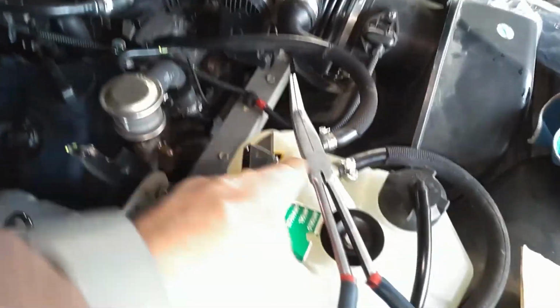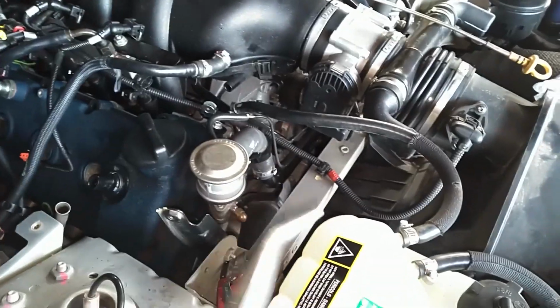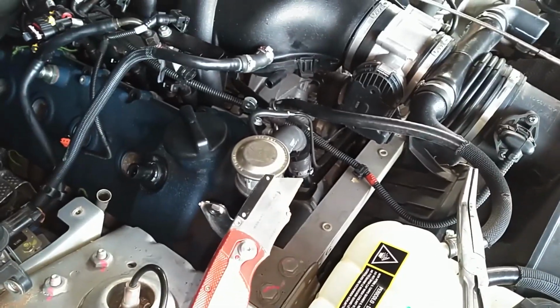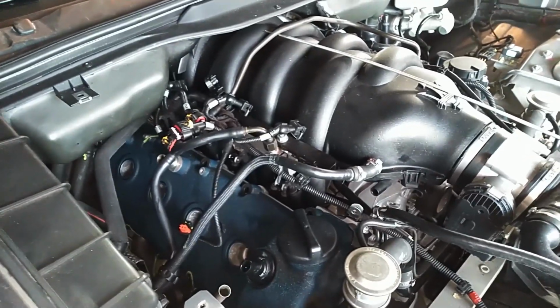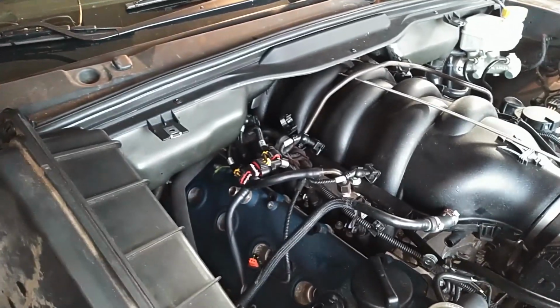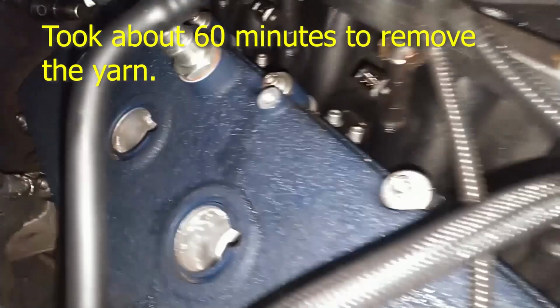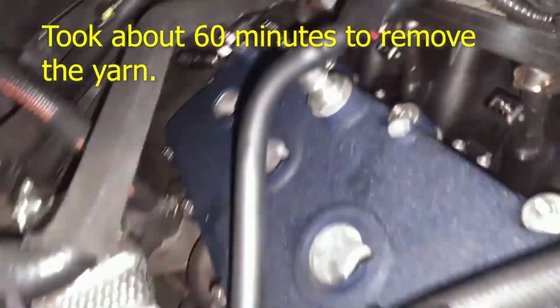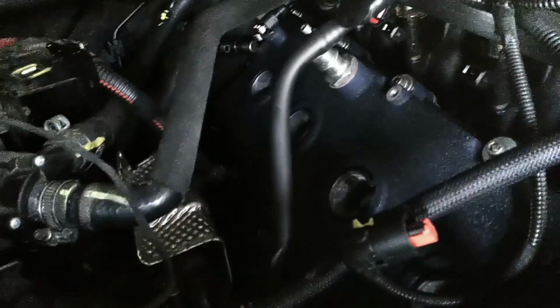With that tied up like that, I put my hand inside the cover, a couple spark plug holes, lifted up on it, guided it back in there, lifted up on this, got it around that tube, got it over this sensor, sat it down in there, pulled this forward, got that in place, and then I lifted up on the back and dropped it down a few times. When I put my hand back there, I feel that tab perfectly in place, and I feel that seal perfectly in place. Both of those humped seals are in their proper position.